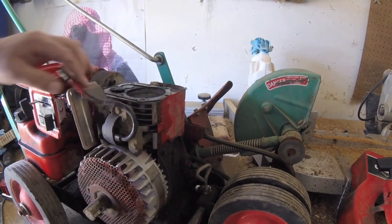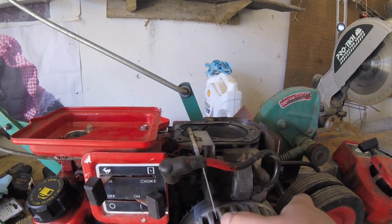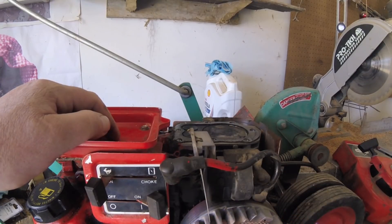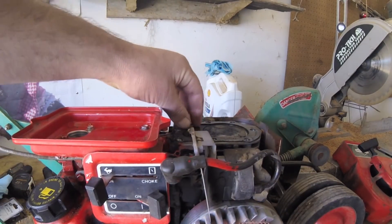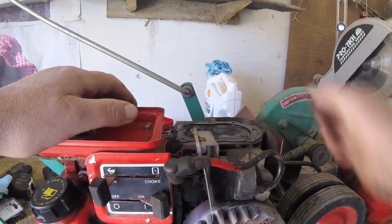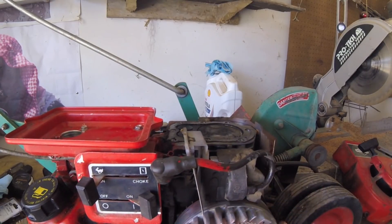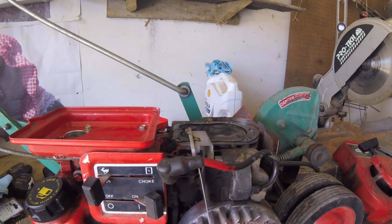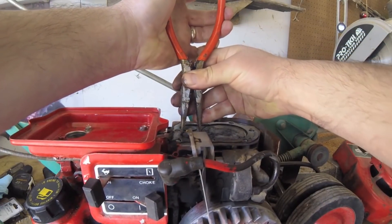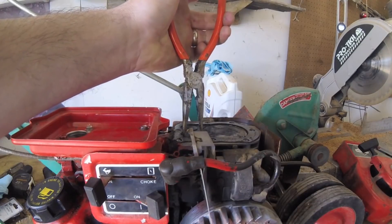This is the intake stroke. Intake stroke — piston comes down, intake valve closes, piston comes up — compression stroke. Right about here is when it blasts. So that's how you want to check these valves. If any of them are turning — nope. There's another trick if you don't want to take it apart to check the valve clearance: get it to top dead center compression stroke and take a pair of pliers to see if you can turn the valve.